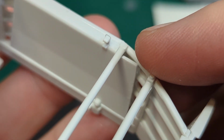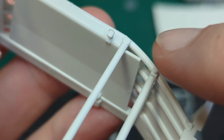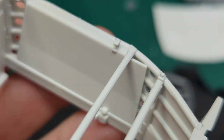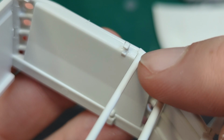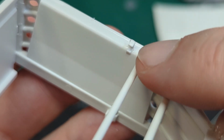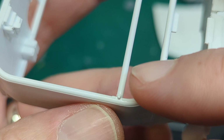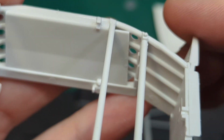I was mentioning a second ago that we had to keep rotating for this to finally drop in, and because of this inner panel here and the way this hole is formed or molded, we just put it in place and kept rotating. It looked like the pin was a little bit off center of the entire rod. So we just kept rotating until it found its home, and then we were happy. It didn't really care over here on this side. So the driver's side seems like the more important of the two.